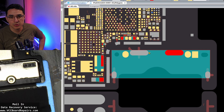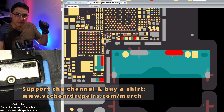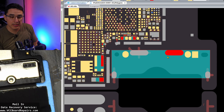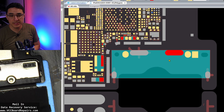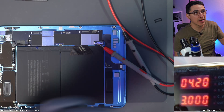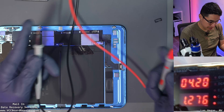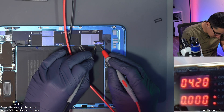The goal is to boost up this battery — just like when your car battery dies and you attach jumper cables to charge it from another car's battery. We're going to inject voltage into this battery and bring up the voltage so that the iPad does not boot loop due to a dead battery. We'll do that with our power supply, which is set to 4.2 volts and 3 amps. The left side is ground and the right side is positive.